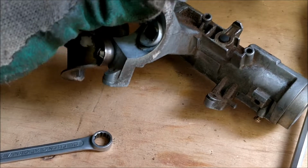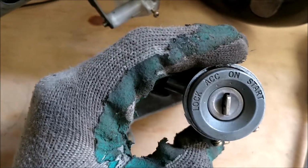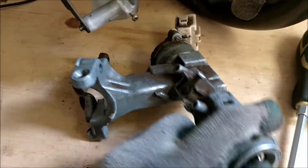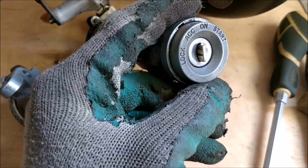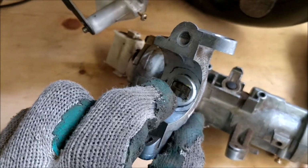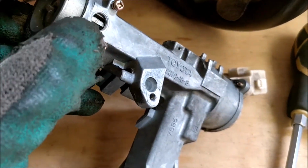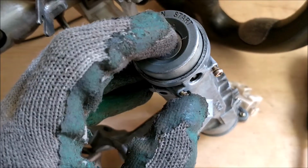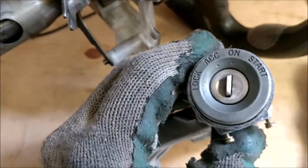So just as an example, this key is cut because during my electronic ignition upgrade, it didn't have room for the whole key fob, and I didn't want the steering locking, so it was chopped and left in there. But basically, when the key is in, there is pretty much no chance that the locking pin can eject. It only ejects after the key is removed. And there's also a missing component here. There's usually a switch of sorts here that tells the vehicle when the key is in, which also works to chime and remind you that the key is in when you open the door.